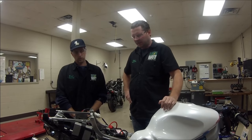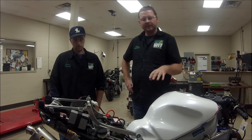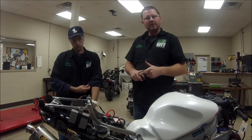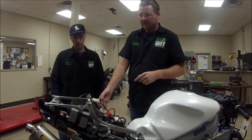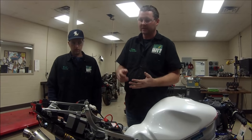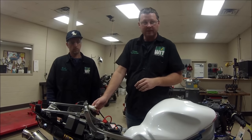In this first part, on our RC51 project bikes, we're going to go through testing the charging system and some of those common tests — from battery testing to parasitic draw, which is current leakage. We're going to do stator output testing and stator resistance testing, so we get multiple functions of our meter: DC volts, amps, and ohms as well.